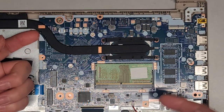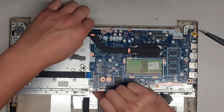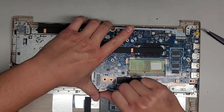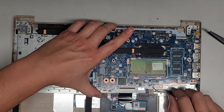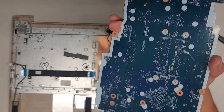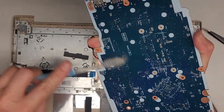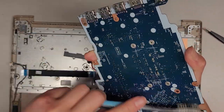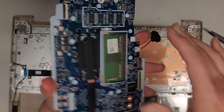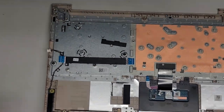Now we're going to wiggle this — zoom out a little so you can see more. Very slowly and gently lift this up — don't try and force it. Don't pull on the heat sink bar because you don't want to accidentally bend it. Here's the bottom of the motherboard — it actually looks relatively clean. We'll just brush it to make sure there's no debris. We don't need anything else from in here — we only need this cable which we'll get out after the motherboard swap.